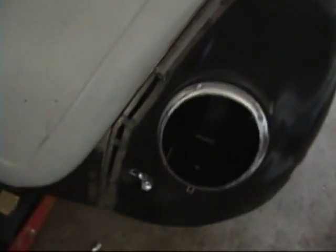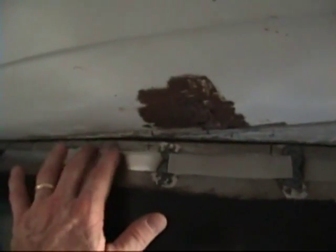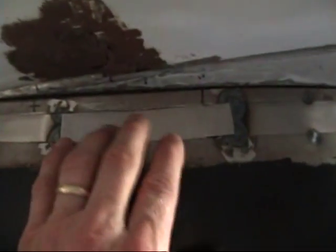Now I'm out here working on the front fender. You can see I'm putting these little pieces in — I was able to get these three pieces in, just right here, right here, and right here, with the welder to tack a couple of welds to hold it nice and tight. I'm building all my little pieces out of poster board — I get the poster board to fit in there, cut it, bend it, and put it on either side. I'm actually filling these little panels up with steel.